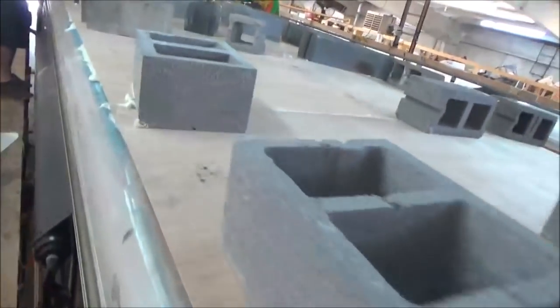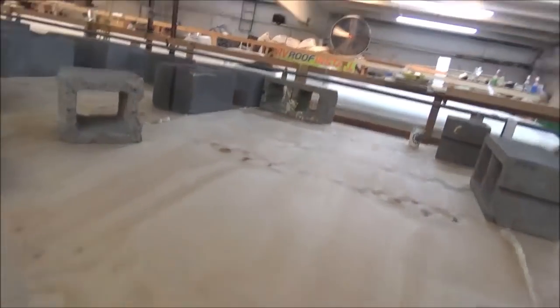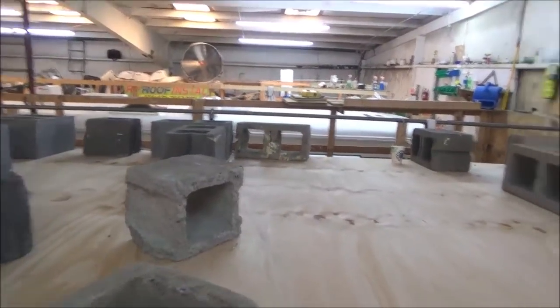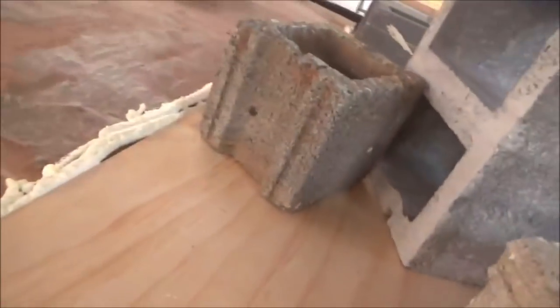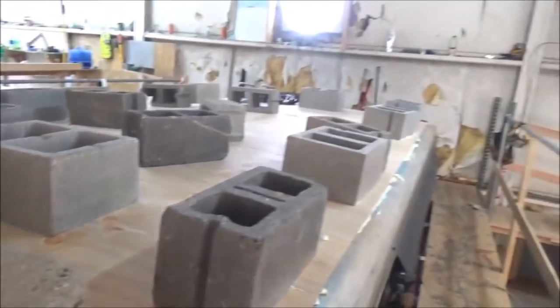So what we're doing now is re-decking this roof. We don't use any fasteners — none at all. We're re-laminating the whole thing right on here. We're doing these cinder blocks, just holding it down until the foam adhesive cures out. Once it gets all cured then we can just move the blocks. Then we're going to get ready to do another round.